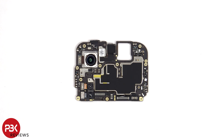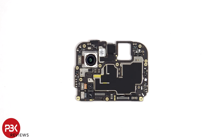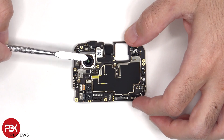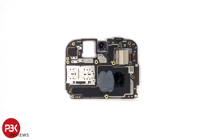Looking at the main board, there's a 108MP primary camera and a 2MP macro and depth lens. The camera connectors can be disconnected by just popping them off. There's a secondary microphone on the top, as well as graphite film over the shield to help transfer heat. There are also rubber gaskets around the connectors. None of the cameras have OIS or optical image stabilization. The SIM and memory card reader is located on the back.